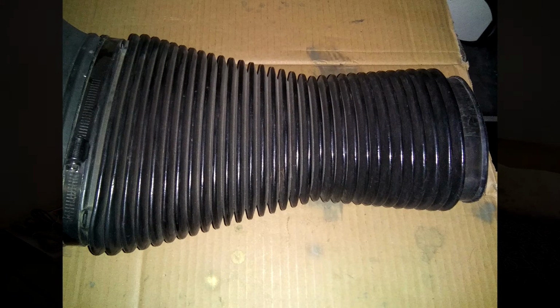Now, if you looked at the ducting on there, notice on the stock one I used the accordion style. Well, you can buy some that are smoother. Honestly, I don't think it's a factor whether you buy a smoother cone or not. It probably is not going to make that big of a deal overall. As you can see with the modified intake system, that's basically just an open 4-inch cone with no restrictions, so I don't even recommend it. I would just use the stock accordion style intake in there. The one thing that is valuable when you do that is to keep it plastic. Plastic doesn't have heat soak. I see some other intake systems put a nice polished aluminum section in there to improve looks. Well, it looks good, but remember, when you add any metal element, it will begin to heat soak. When that heats up, it'll heat up your charge air into the motor, which will eventually deteriorate some performance.